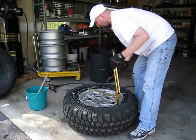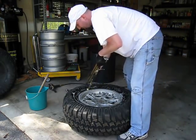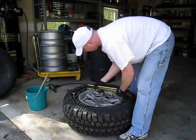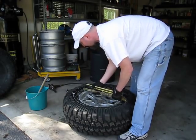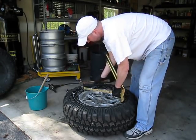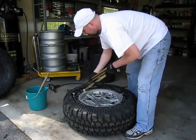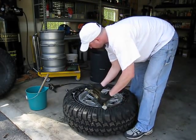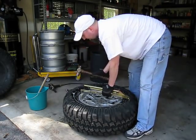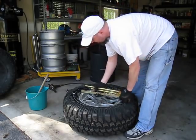It may take a little bit of doing. Once it's in, we're just going to use this to kind of pry up a bit — do it a couple times. Be careful not to lose control of it; it won't pop out too much. Then we're going to move just a couple inches clockwise or counterclockwise and do this again. Essentially what this does is it just helps to loosen up the rim — it's not popping the bead, but it's loosening it up enough.